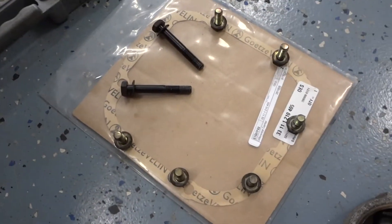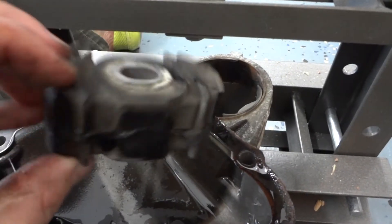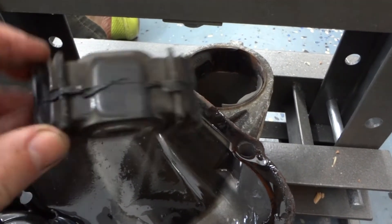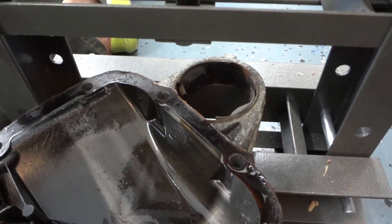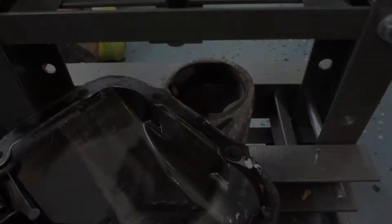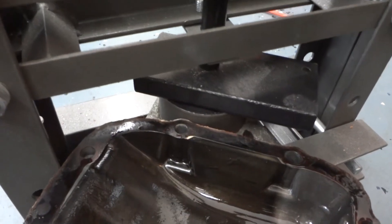The replacement side by side — it does look like it's biased to the top by design, but you can see the way it's pulling away from its housing, it's quite wore out. First attempt in the press and the centerpiece completely separated from the ring in there, so about seventy percent of the way through. Now I've got the new one stacked on the outside of the old one to try to press it through.